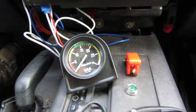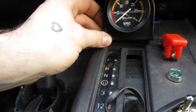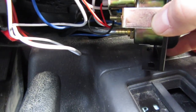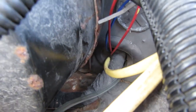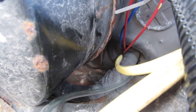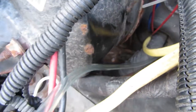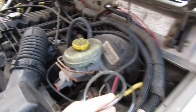So now I've got the cutout in my stack, I've got this thing wired up. Next we're going to run the vacuum line — let's go to the engine bay. I got the vacuum line run. It's run to the gauge up through the dash and out into the engine bay via this port right here — that's where I run everything else, that's where everybody runs everything. There's a port on pretty much every vehicle underneath the driver's feet that allows you to run wires or hose from the engine compartment into the cab. So I've got my hose run here. Now we need to choose which vacuum line to tap into.